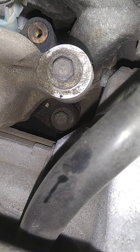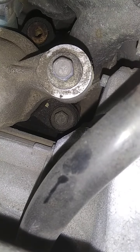Yeah, definitely smoke coming out right in here. Yeah, there's your smoke trick. I'll probably start it and run some propane down in there. Oh, man. That ain't no fun to pull that off. I've had to do it before to change the plugs and stuff. You gotta take all this off of here to get clearance so you can get to the bolts and get this off.